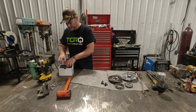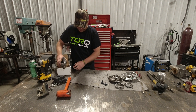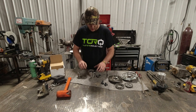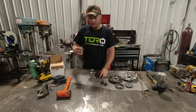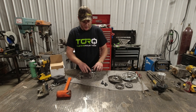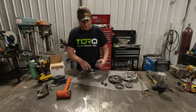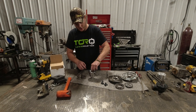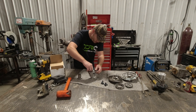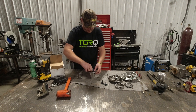Let's show you this beautiful masterpiece. When you get this it will be 99% assembled. These are your new axle gears made out of 9310 — really strong material, really durable. Inside the carrier, in between your two cam gears, you've got two springs. These will already be in the carrier; just make sure they are standing straight up and aligned. Shipping can do some nasty things, so verify those springs are standing straight up and ready to go.